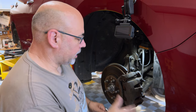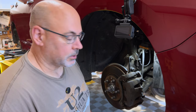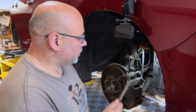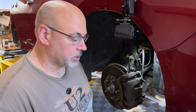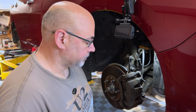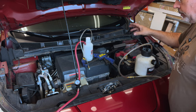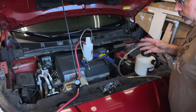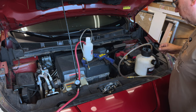It's almost easier to do this on the ground or close to the ground so you don't get fluid all over the place. It's also easier to keep the thing full. We'll go ahead and lower it, and then we'll flush all four sides — put about a liter through the system. We're going to do the pressure method, which if you're doing it by yourself is kind of hard to beat. I explained earlier why I don't use any type of suction down at the calipers.